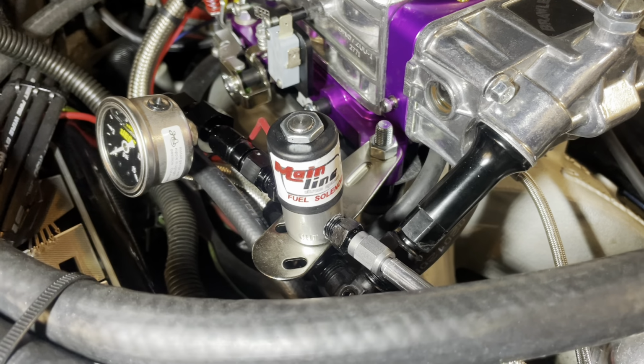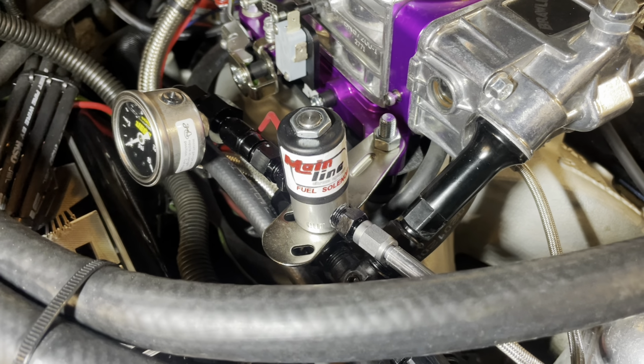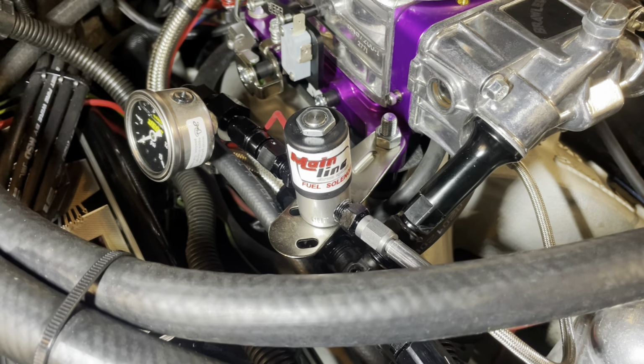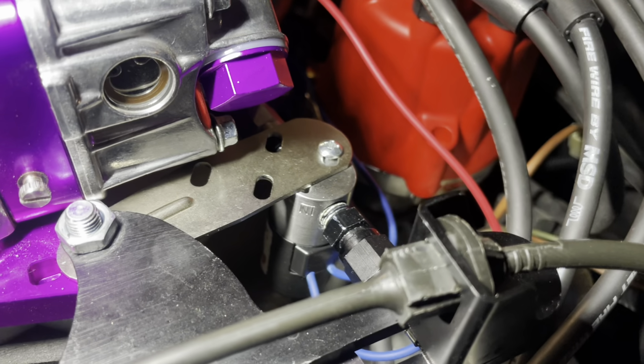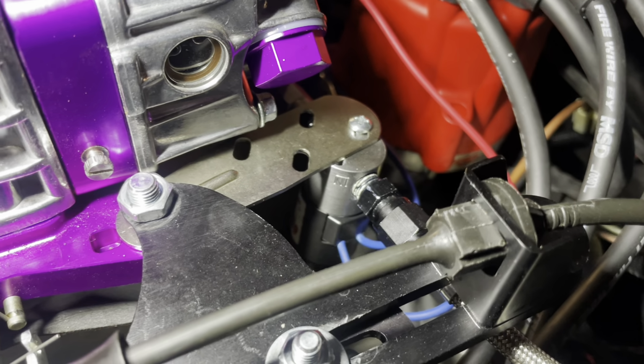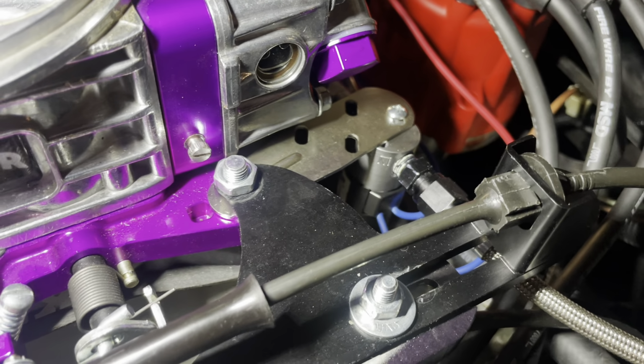The solenoids are intended to be just hung by the steel nitrous fittings and lines that the kit comes with, and I elected to upgrade that and mounted the solenoids rigidly using some NOS nitrous solenoid brackets off the carburetor studs, because that's what Jeg's had at the time when I was there. And the nitrous solenoid actually hangs upside down to give clearance behind the carburetor so it's not sticking up in the way of the throttle linkage.